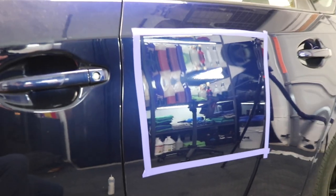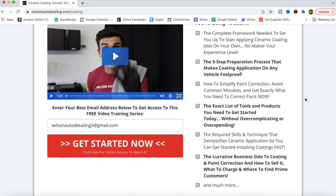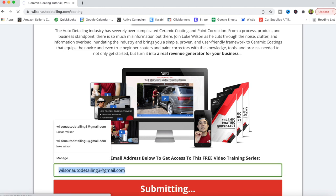Because I actually did the worst case scenario here, you guys are not going to be doing worst case scenario — it's going to be even easier to fix than this. The paint looks really good because it just got polished, and there are no streaks anywhere. Where you used to be able to see that bubbly appearance — that extreme high spot — you can't see it anywhere. The coating has been totally removed. A lot of times as a beginner you might think, 'Oh my gosh, if I screw something up, there's no going back.' That's really just not true. That's actually why I wanted to show this in an extreme situation — mistakes can be fixed. Yes, there are situations with really thin clear coat where it might be more nuanced, but this should give you a lot of confidence as you move into ceramic coatings.